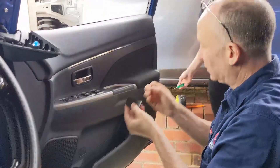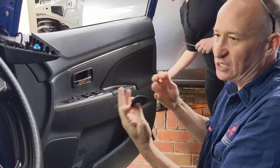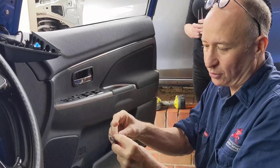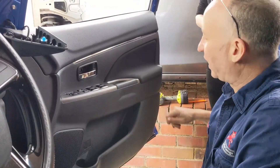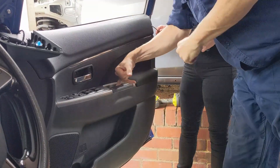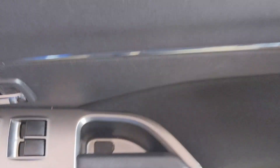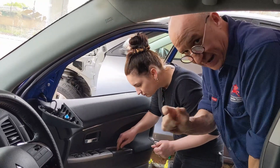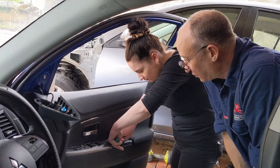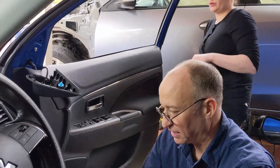It's a good idea to keep these collected together. If there were going to be 20 or 30 bits, I'd be creating little buckets and putting them in little buckets. Because there's only going to be a tiny number of parts, I'm just going to put those off to one side. Now Rach, there you can see that little tab there. There's a little cover — Rachel needs to use a flathead to pop it up, and underneath there's going to be a Phillips head screw. Rachel needs to undo that little Phillips head screw.